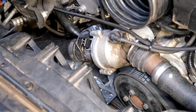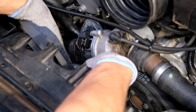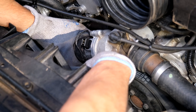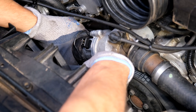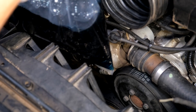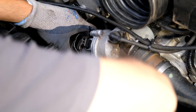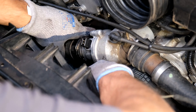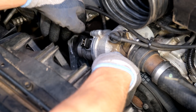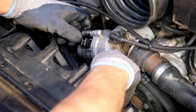All I need to do is pull this pipe downwards — there's no twisting, just that way. Yours might be pretty tight. I've got the bag here to collect the antifreeze which I'm going to reuse. I'm not going to pull it out completely, just allowing it to come out a little bit so the antifreeze can start to seep into the bag. I'm moving this pipe out of the way and letting the remainder drain into the bag. Now I'm going to open the thermostat and let the other side drain into the bag as well.